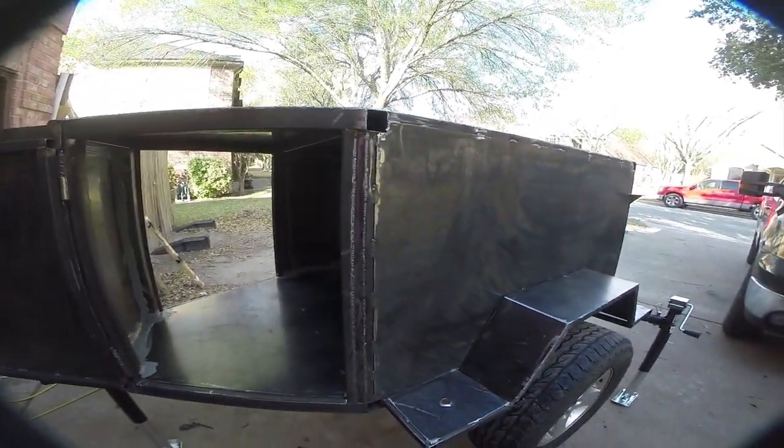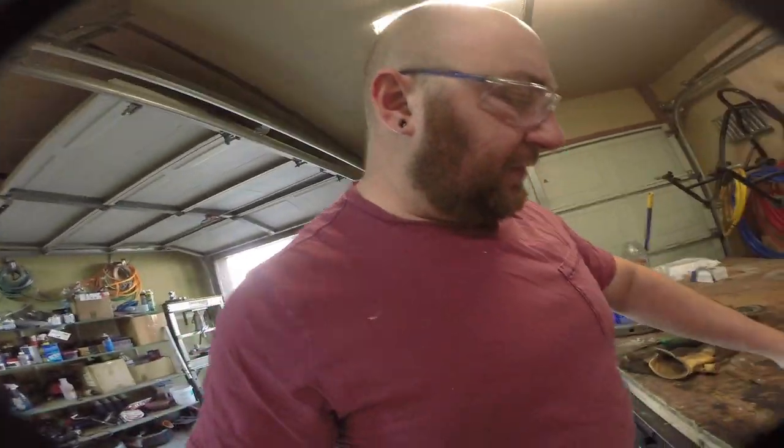Next up, we kind of finished grinding everything down, wiped everything down with acetone on the inside, and then put down our first layer of seam sealer. You can really smell this stuff — it came with a California warning, so it's the real deal. I've used this brushable seam sealer before — I'll put a link in the Google Doc in the description. It takes about 20 to 30 minutes to cure fully, then we're gonna do a second coat. I'm just sealing the outside walls — everything else is finished welded or will have gaskets. Once we paint everything black with POR-15, you won't even be able to see the seam sealer unless you're really looking.